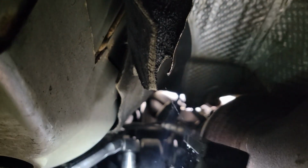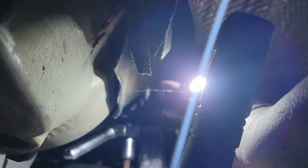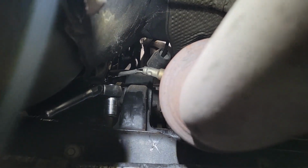Hey, this is the back of the motor mount, these 2 bolts. They're still 16 millimeter also, but they're much easier to get onto with a ratchet wrench, whatever you've got. There's one there and one right there beside it. I already took out one, but they've got some room there. A 16 millimeter flex head ratchet wrench would have been really nice. My set skips that number, but it goes from 15 to 17.